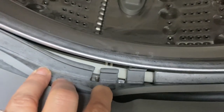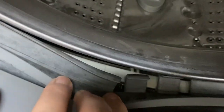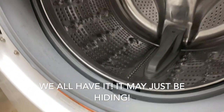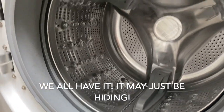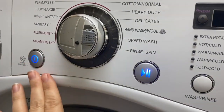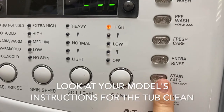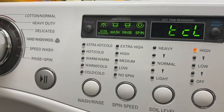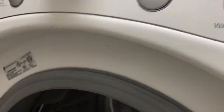After five cycles it's pretty amazing, because normally that little area — you can see that gray stuff back down there — it's like sludgy all over. Every washing machine is different, so you'll have to find your cycle. This is the button I have to push — it says 'Tub Clean,' you hold it down, and then it's ready. That's the cycle I run these on.